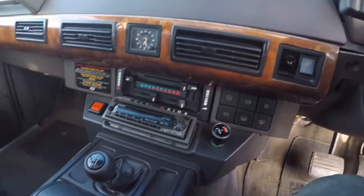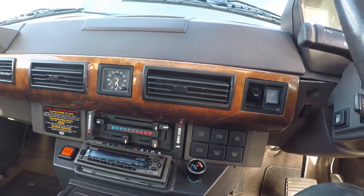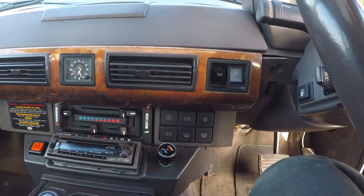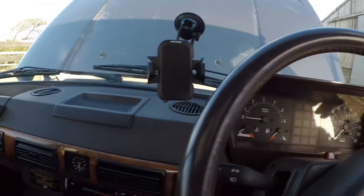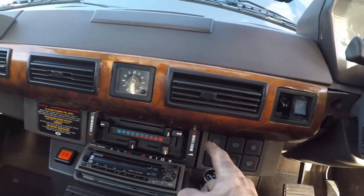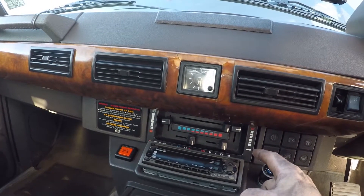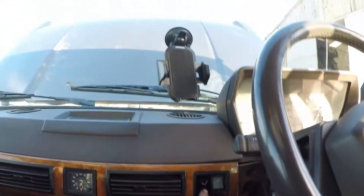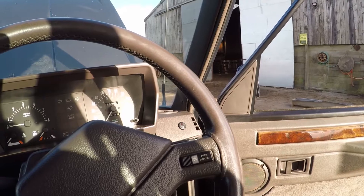I haven't actually tested the rear window heater and front windscreen heater yet, but when I press the buttons I can hear the alternator take on further load, which means they should be working - nice, because I really want the front heated windscreen. The lights and all the stalks light up fine, but we haven't got much backlighting on the lower controls so we've got to fix that. Blower motor-wise, some of it works but I can't seem to get any hot air or any blowers at the top vents, so I've got to suss that out. On the mirrors, the passenger side works fine, but the driver's side will only go up and down even if you press left and right, so that's got to be sorted.